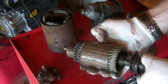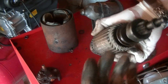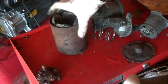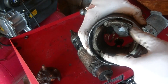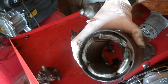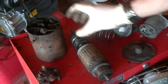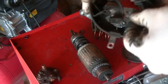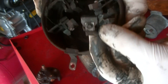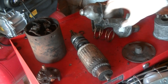This is just an electrical motor — it goes past the scope of this video to explain exactly how an electric motor works, but that's all it is. It's a really big motor that takes a lot of current. On the outside you can see coils of wire, just like any electric motor. A lot of the time, the brushes are what go bad, and all you need to do is open it up and replace them. Either the brushes go or the solenoid goes — both you can repair.